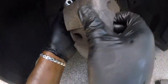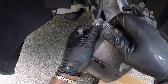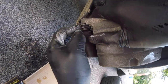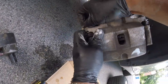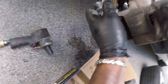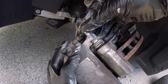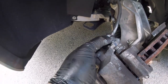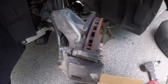Once you're done with the anti-seize, take your caliper, place it on the brake pads, and line up our guide bolts like so. Take your 14mm and start by hand — same thing up top, start by hand. Now let's tighten these up.